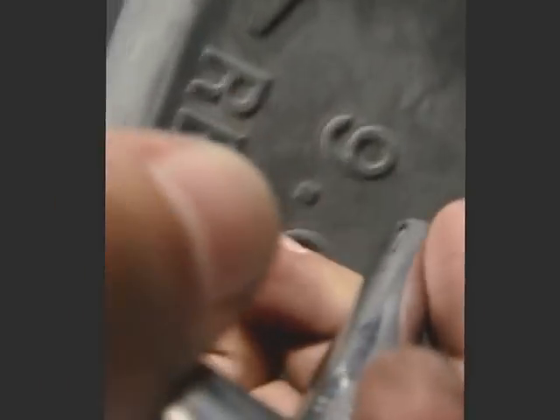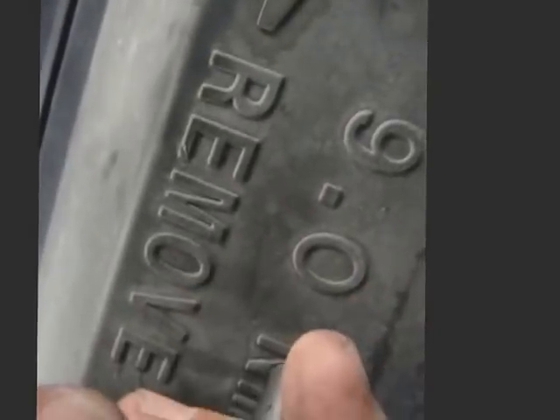While the oil drips out, I also need to get at the oil filter. I'm looking at the engine undershield — we'll need to loosen this because the oil filter is tucked away underneath. Right here we have a 9 millimeter nut we'll need to loosen, and there is another one as well. It says 9 Newton meters, and we'll have to tighten those nuts back up to that torque spec once we're through the procedure.